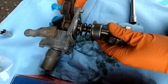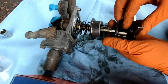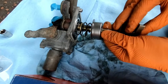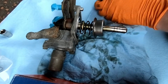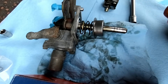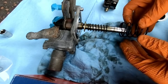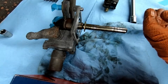I'm slightly rotating the bolt as it comes out. Keep in mind there's a washer just under the bolt, and there's also a spring on the lower part of this assembly — I'm holding it together with my fingers as I remove it. I'll set that aside and put the washer under the bolt for safe keeping. Then I'll remove the spring hat — one spring there, the second spring — set them out to the side and get the new springs.